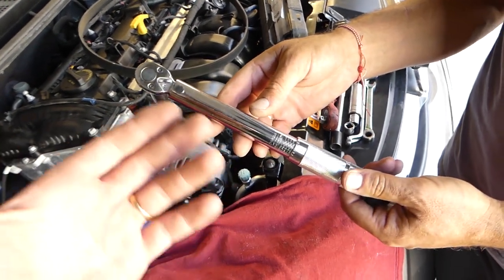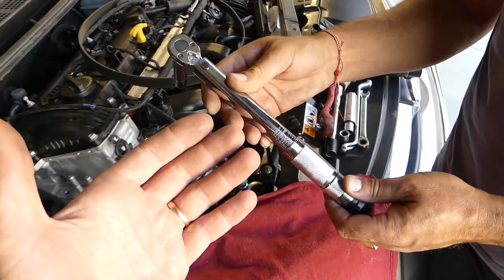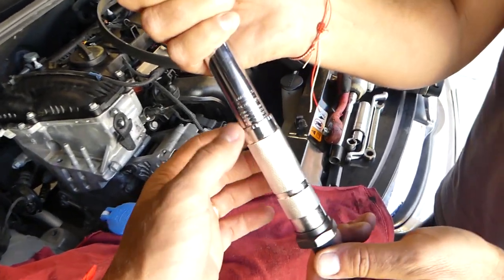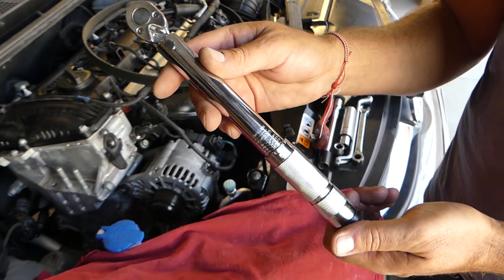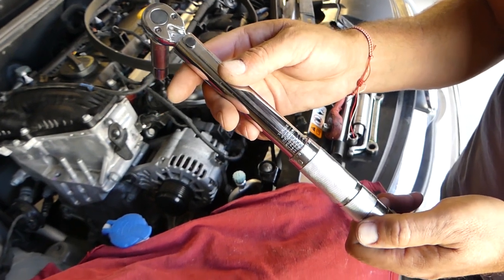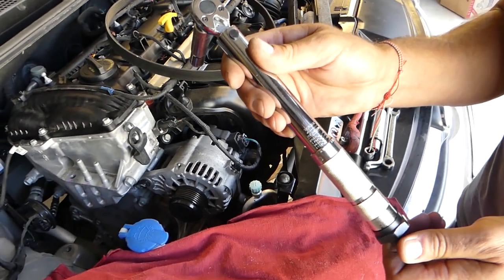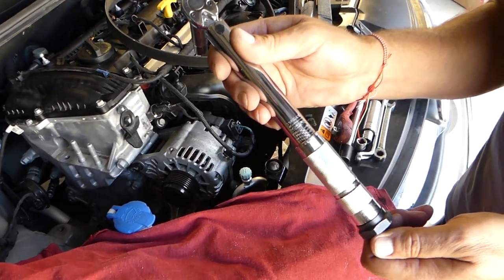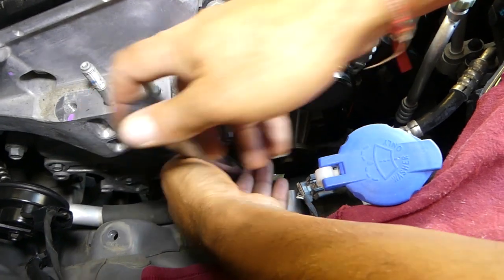We're ready to get the pump tight now. We have the torque range here — you can check out where we got ours from in the description of the video. According to the manual, you need to go anywhere between 9.8 Newton meters to 11.8 Newton meters. Ours uses inch-pounds because it's a small version — we like it a lot because it's handy. Inch-pounds will be anywhere between 87 to 104; you can do the conversion online, pretty simple. So we'll be going between 87 and 104 inch-pounds, and we'll set ours at about 100 inch-pounds. You'll see the torque wrench handle will move when it reaches that optimum torque.